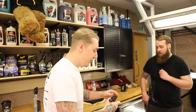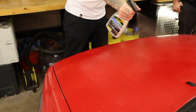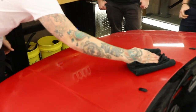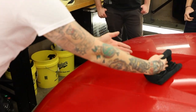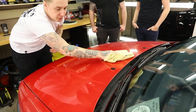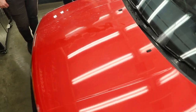The reason I've got two different colour cloths out is because once you've sprayed it on there and got it nice and lubricated - and you can use this on the wheels, glass, anything like that - get your first towel and wipe in nice, clean, straight lines. I picked the towel up like that so I've constantly got a nice, clean bit of towel rubbing on the paintwork. Then with the second towel, buff in the opposite direction. This way you'll never get white lines. Ever.